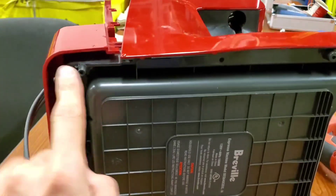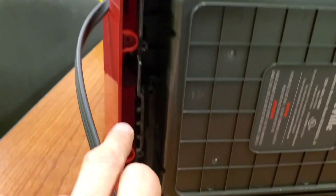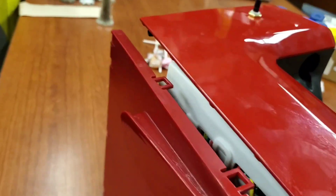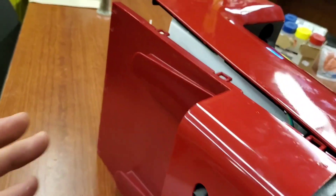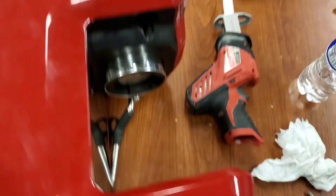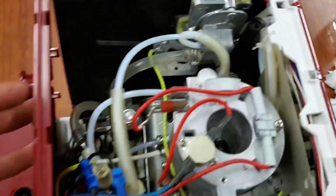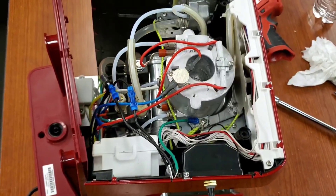The easiest ones were on the bottom of the machine. There are two rails that run along here that have feet in them. One foot has two screws, then there's the screw that holds the whole rail on, and then there's a foot that has a single screw. You need to take those off to get to these two screws which go into these sets right there — there's two of those — and that is how you get this whole thing off. You can see these three clips; there's three on the other side holding onto little catches on the inside. Basically, you just want to grab it low, get a good grip on it, and jerk it back to get it loose without breaking the tabs. I actually broke one on the other side because I wasn't forceful enough with it. There are a few other little screws you'll come across, so just take your time.